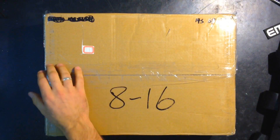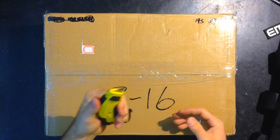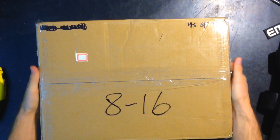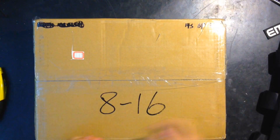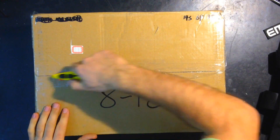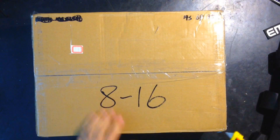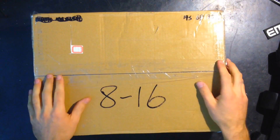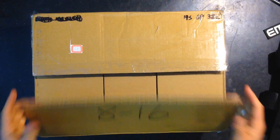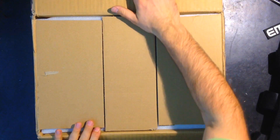Now for the battery — this is where the quality is packed. The box is really tough, and it's got a plastic layer everywhere in case of any liquid exposure. Inside there are lots and lots of layers of protection. This is a 14S 52-volt high performance battery, 6P 32E — actually Samsung 32E cells — very reliable cells that Paul loves.